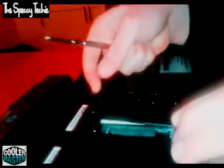What you want to do then is unscrew that and lift the panel up. The panel should come straight up with no problem. So what you want to do now is push both clips — these little clips here — push them both out and the RAM will pop up.